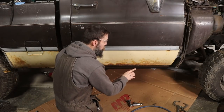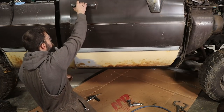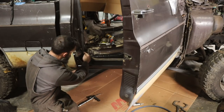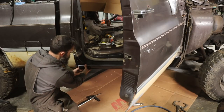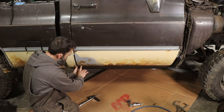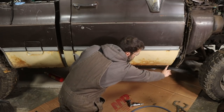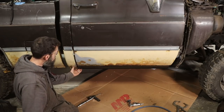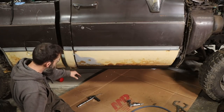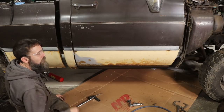Looking at the rocker more closely, the problem is that it's not too low — it's twisted just ever so slightly. So I left the tack weld in the back, ran a cutoff wheel down this joint, and just slightly twisted it out a little bit. Checking the joint again — a little bit tighter, almost to the first knuckle. It's still just a hair loose on this end but looking down that body line it looks really good. I don't want to raise it any farther because it'll start interfering with the bottom of the cab corner, so that's good enough.